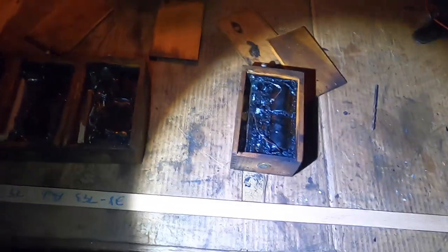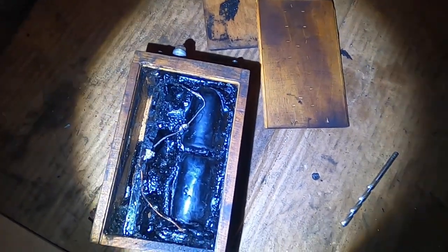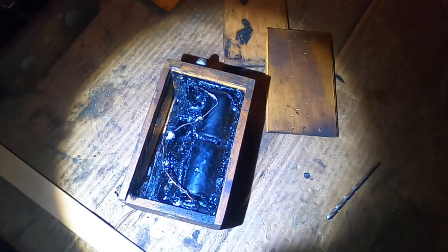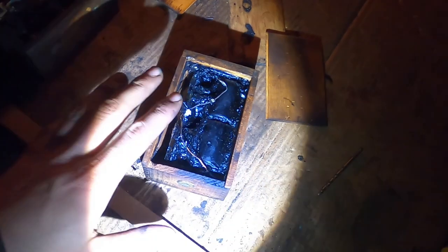I'm ready to repot these with tar and I have put the new capacitors in. You might notice I have five coils instead of four. One of my coils was bad and it can be fixed, but it's going to be a bit of a pain — the primary windings are okay but there's some wire buried in tar that's broken. I can't find it without digging around those windings, so I'm probably going to use a heat gun to melt it out when I redo it. I actually happen to have another coil that was good, so I'm not going to work on that bad one right now, but I'll have it as a spare.